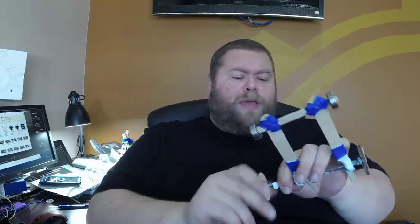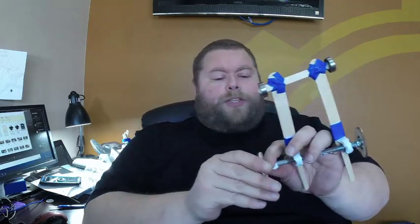You want it to be tight enough that I have to screw this to make it go in. I have to be turning this around. You want it that tight, so that it's not going to change with the wheel, so it's not going to change direction with the axle. The axle will rotate the same as the wheel, because if it doesn't, then you're not going to get any traction. I'm doing this. This is going to take a second.